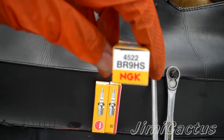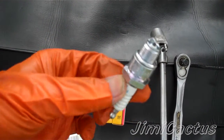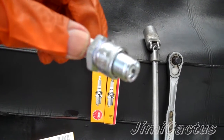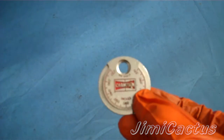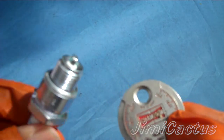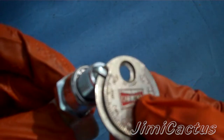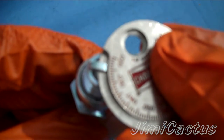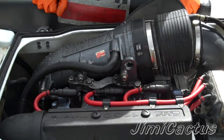For the Wave Raider, these are the spark plugs — about three dollars each at AutoZone. The gap is between 20 and 24 thousandths. I use a coin feeler gauge. You slide the small part in, slide it right down, and it should fit snugly at 24.